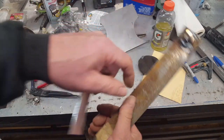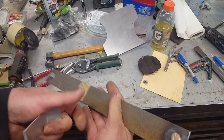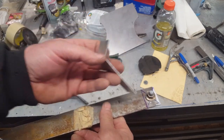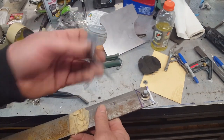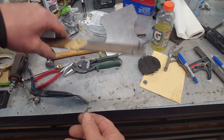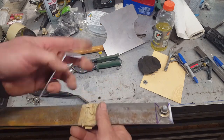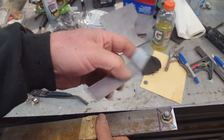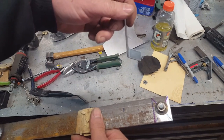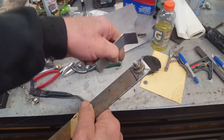And what I'm doing right now is I'm welding a capture nut on the back side of the bracket. So while it's still flat before it's bent, and this is not always possible depending on how close the welds are, so you've got to basically judge by the situation. While it's still flat, it's easy to put in the drill press, so I have a lot of control over the piece. Now you can imagine if I made my bracket up and then I decided to drill my hole and weld my nut on there, trying to hold it up at this angle, it would want to whip around, and I'd have to hold it, probably put it in a vise and drill it by hand.